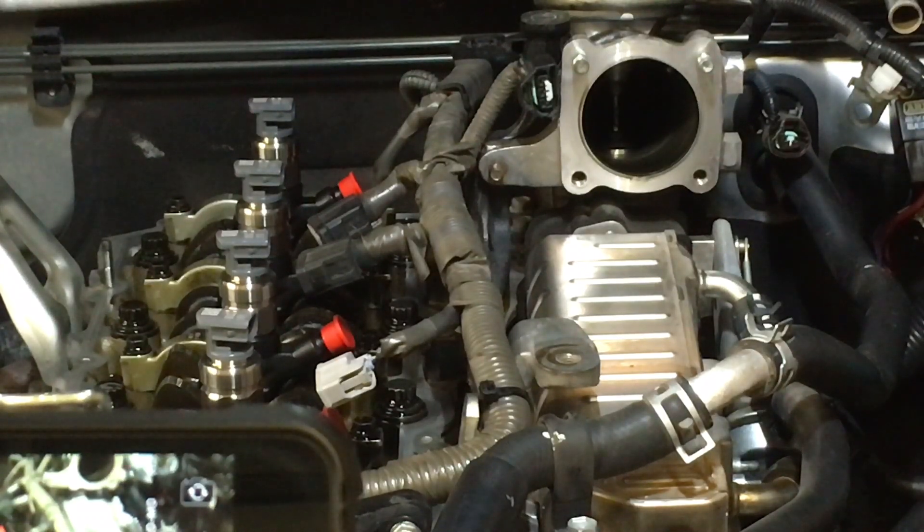What I mean is you cannot — well, you can — it'll run fine. A new set of injectors without the compensation codes put in are going to be working better than an old worn set of injectors even if the compensation codes are in. So it's less important than getting your injectors replaced, obviously depending how bad they are. It's the fine-tuning of the injector. It's ideal to put those in. Heaps of people start the engine and drive the car — there's people online who haven't done it for six months, a year, two years. Of course it's better if it's done, but it's proven you don't have to because people don't do it and it's been good for years. I advise you do it — that's the right thing to do. Keep it running in peak performance — it evens up the horsepower between the cylinders, adding or subtracting fuel at the right time.